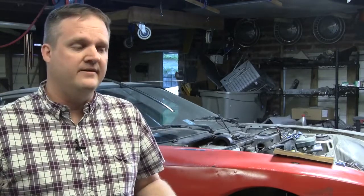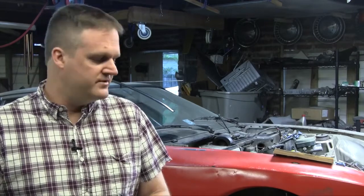Since I was probably going to have to rebuild it anyway since I was taking it apart, I thought, what does my old engine look like? I went back and looked at that, and the cylinder walls did look much better, but the cylinder to piston clearance measurements were out of tolerance. So I guess I wouldn't be able to use that.